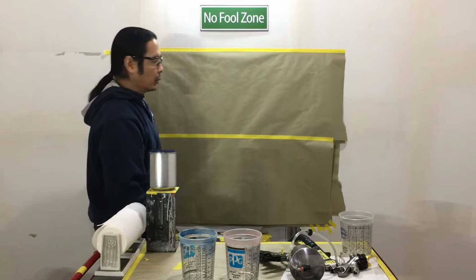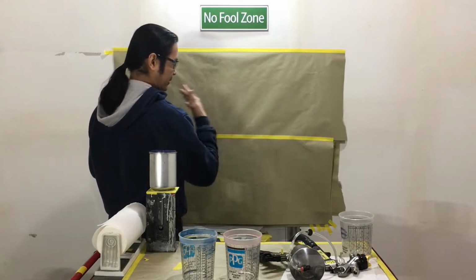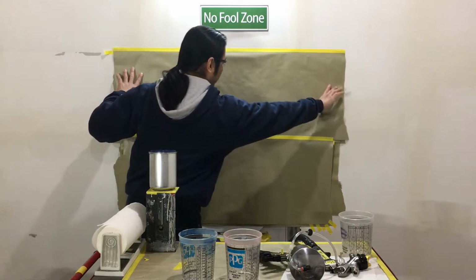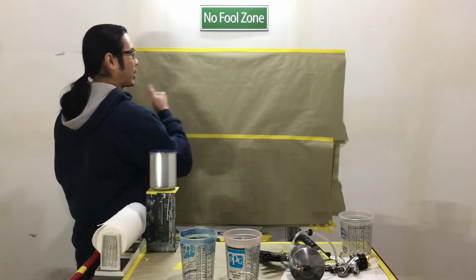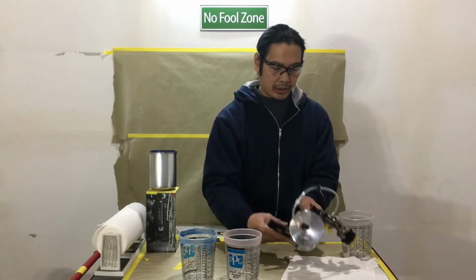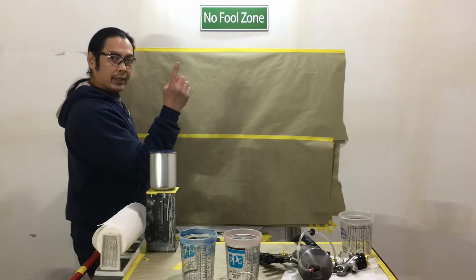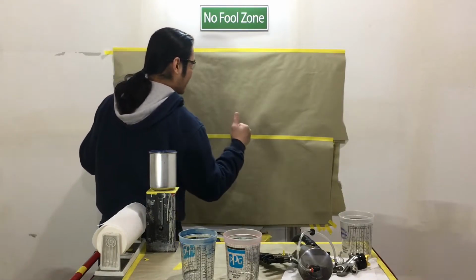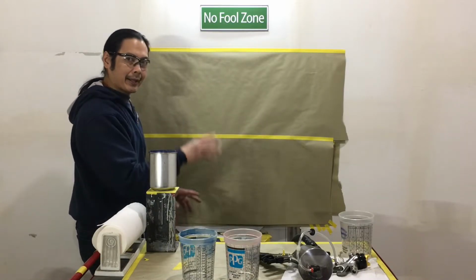It's just the facts. When you're using HVLP, you have to flow with the rate of that particular gun, and you can move at a pretty good pace. If you count the distance a painter will cover in a large size door, it's gonna be about 3 seconds with an RP gun. It's gonna be about 4 seconds with the maximizer. Now, there's a reason for that. One, the painter. Each painter has a different way of painting. Some people like to hose it on and move fast. It's almost like going fast and hoping it hits, hoping it doesn't run. There's a lot of that going on.